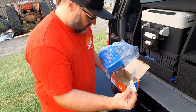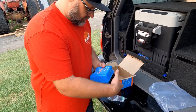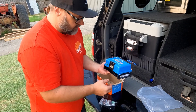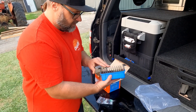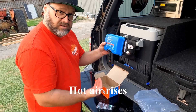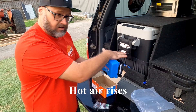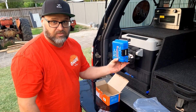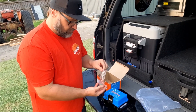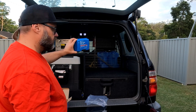In the box we've got a little plug with a jump lead that goes in the bottom — that's for a remote on/off switch. There's the manual. Nice compact unit — there are your terminals right there, with a big heat sink on the back to keep it cool. When you install it, take care to note that it's going to use natural convection through there, so you don't want it sitting on anything and you don't want anything hard up the top — you don't want to install it like that because then it's not going to work. This little jumper won't work if you don't put it in — it just clips in there. Screw it on your wall, job done.